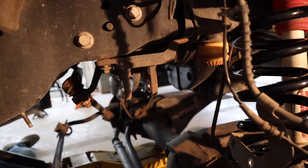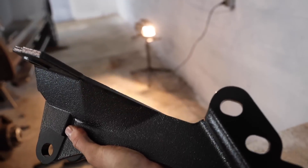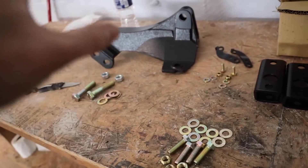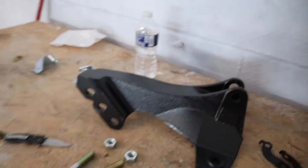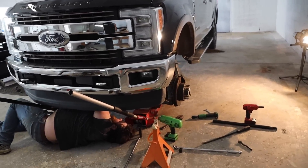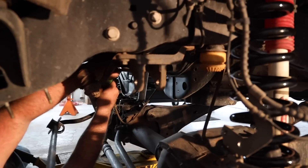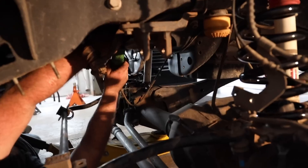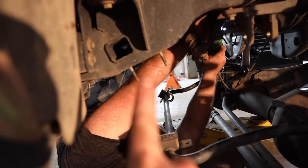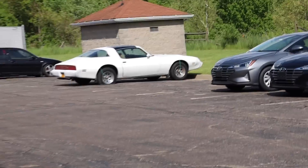Now we're working on the factory track bar bracket. These bolts are 18 millimeters, and there are three up on the upper side. We pull the factory mount out and this is the new mount that goes in. You could have gone with an adjustable track bar and used the factory mount, but this is more of a budget-friendly kit so it just includes a new mount. We're using the factory hardware — just don't lose the bolts. Once that's in, put the track bar back with the factory bolt, raise the axle, sway bar drop brackets, then shock extensions. This kit is ready for alignment.